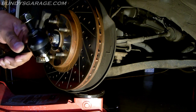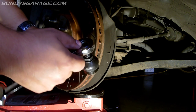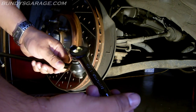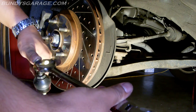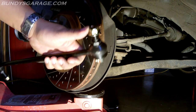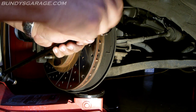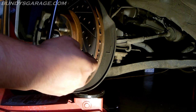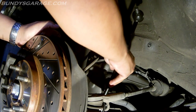Now I'll double check that this nut is still 17 millimeter, which it appears to be. It's always a bummer when you get in there and there's a new nut on something and you think it's the old one — yes, it is 17 millimeter. Go ahead and install those now. Installation is reverse of removal — this one will be sticking out and this one will be going in.